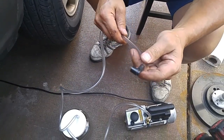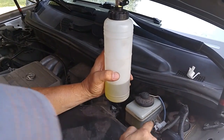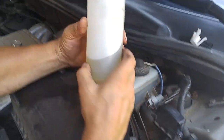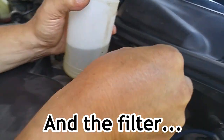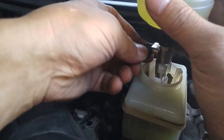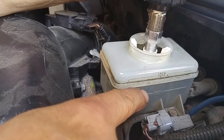This is great for doing a brake service where you want to drain out all the brake fluid from your system. If you want to do this as a one-man operation and you don't want to keep revisiting the brake reservoir, fill this up with brake fluid, remove the cap, turn it upside down, attach it to the lip of the container, open the valve, and it will fill in air pockets. As the fluid level drops, new fluid will be introduced — making this a complete one-man operation.